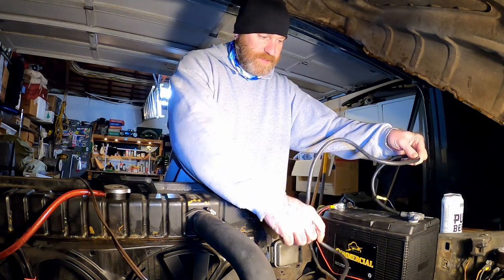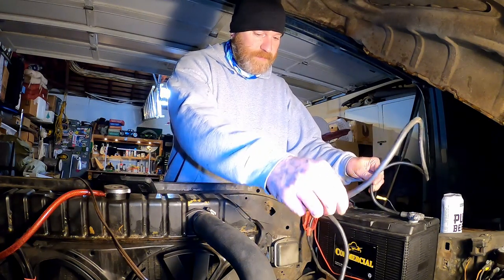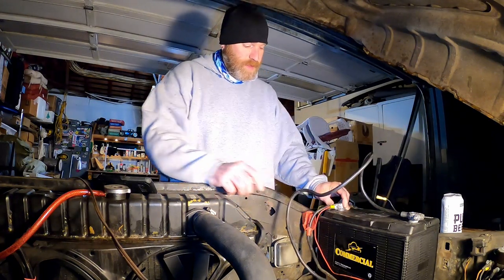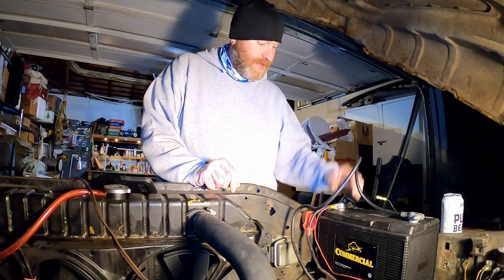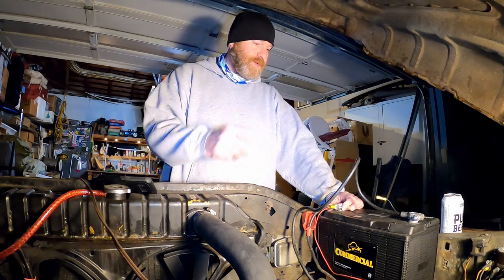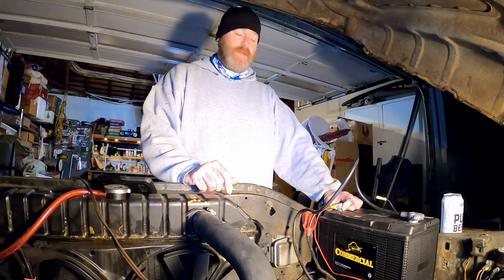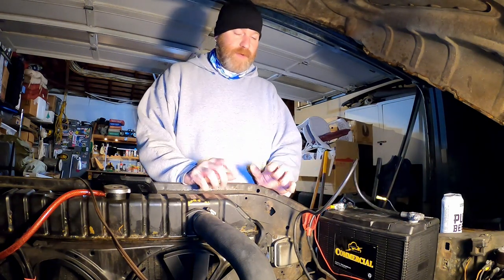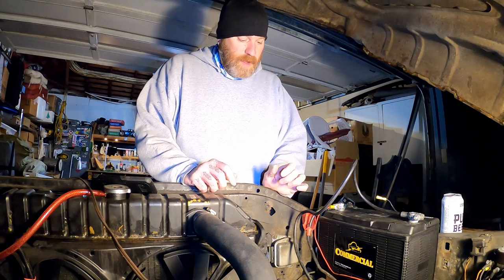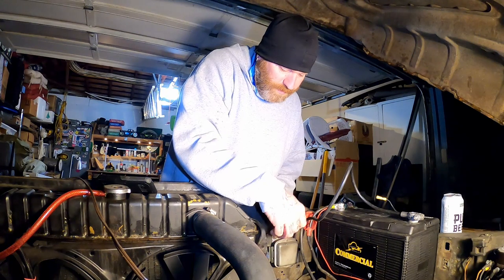The cable was too long — it's just a store-bought predetermined length that they threw in. We're gonna shorten that up. While we're doing that, we're gonna add a new terminal so they match. Doing it budget-friendly for right now because part of the airbag install means I'll have to relocate the battery. One issue they found was the voltage regulator was loose and jiggling around — though it was still charging, it may have caused intermittent shorts.